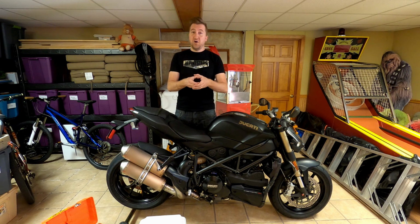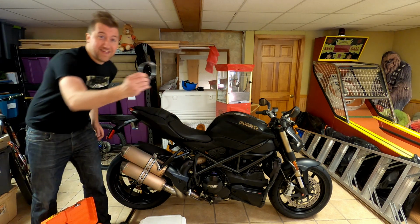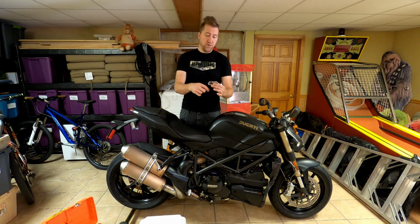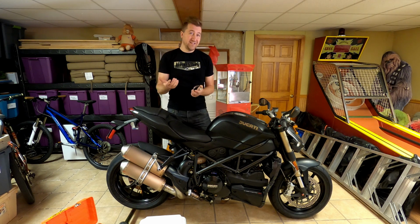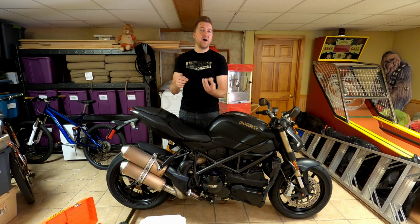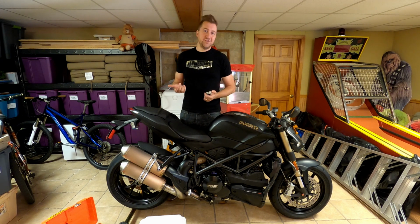What that means is you just get a hose clamp similar to this, and it will wrap around the filter, and then you will loop a safety wire through it and then hard connect it to something on the bike, another nut or a screw or something. When this is cinched down tight, the oil filter can't back out. On top of that, if the oil filter turns a certain way, you have it pulling the opposite way, so it absolutely cannot unscrew. If it's pulling in the same direction it takes to unscrew the filter, it's not going to do any good.